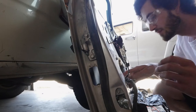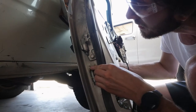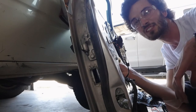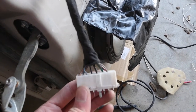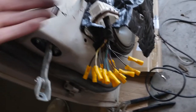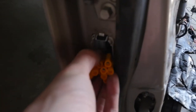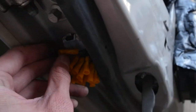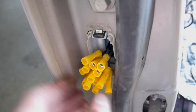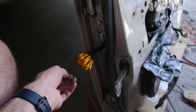Now I can just pop this right back in there, pop this little locking tab back in. Better than factory, baby. Now I'm going to pop all these wires out of this little block, strip them back, and get them ready to connect through the tunnel. I've got all these little butts attached, got them strung through the waterproof thing, slipped the wires through, got them pulled through. Hopefully I'll have enough room to peek in and see what colors I'm working with and to crimp — it's going to be really, really tight. Now I've got a good chunk, so I'll have plenty of room to crimp.